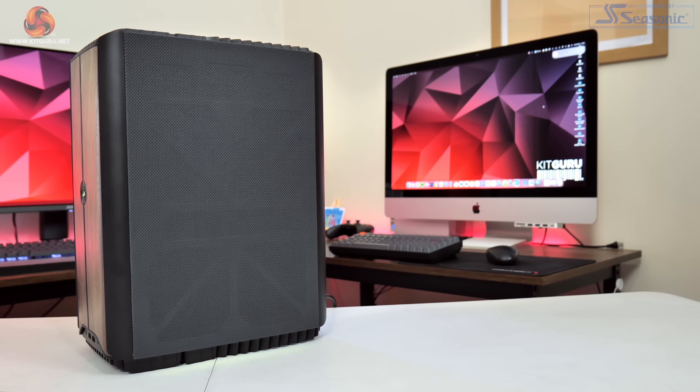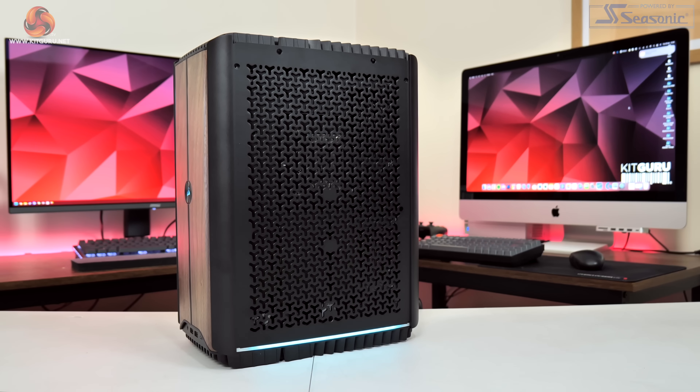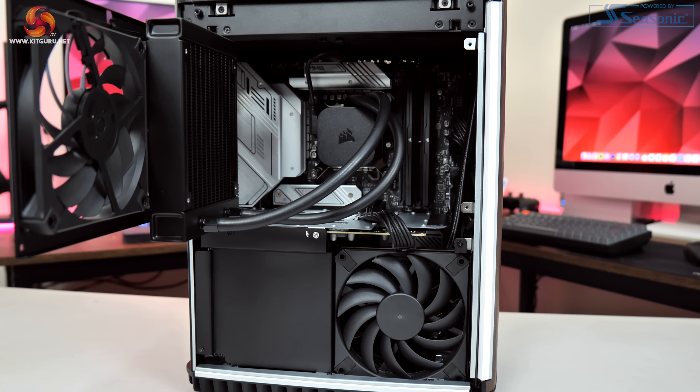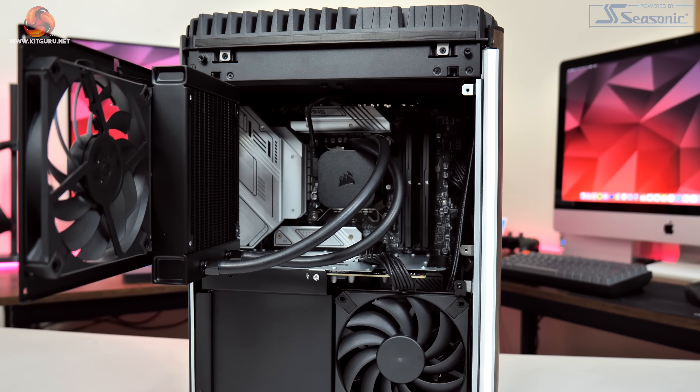So that is really going to do it then for this revisit and follow-up to our original Corsair One i500 review. After we saw a bunch of your comments on the original video, I just wanted to make this so you can see all of the testing we would normally do for a pre-built system review, and also do additional testing like the GPU VRMs that I wasn't able to do in the original video. From all the testing shown in this video, the Corsair One definitely could improve in regards to its cooling, particularly with the CPU. While the i9-14900K is technically just about okay at around 90 degrees, it is still incredibly loud — hitting between 48 to 49 decibels — and I really think Corsair should have gone for a 240mm all-in-one for the CPU using proper 25mm fans.